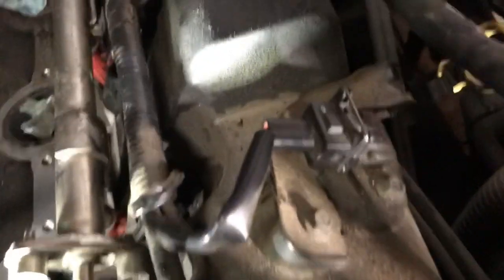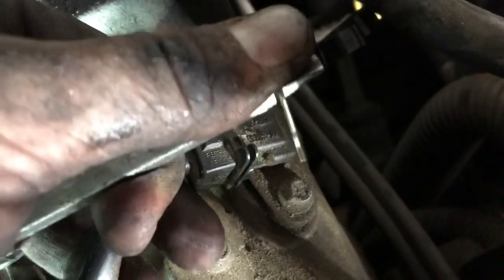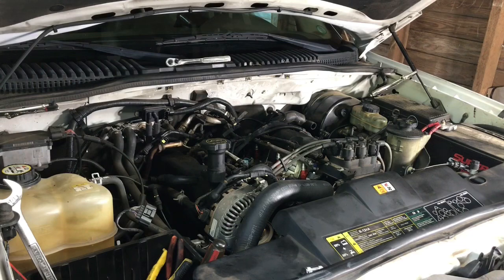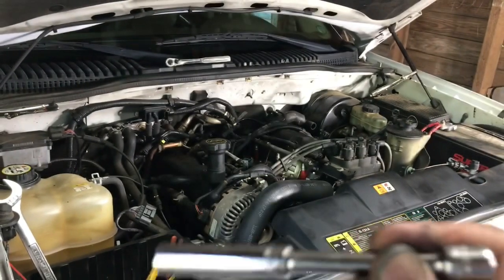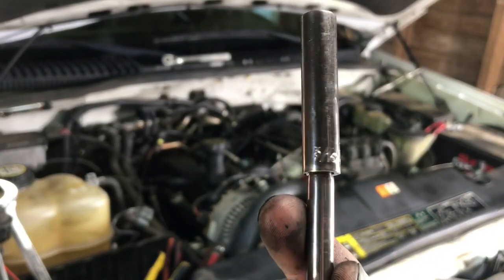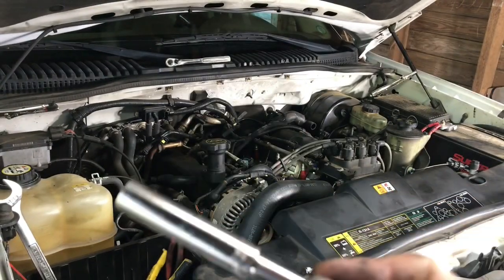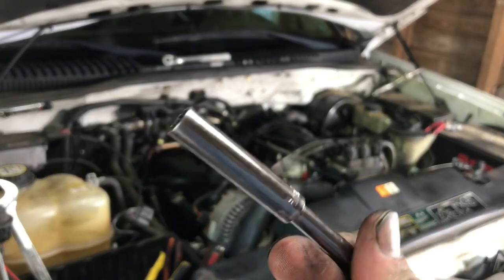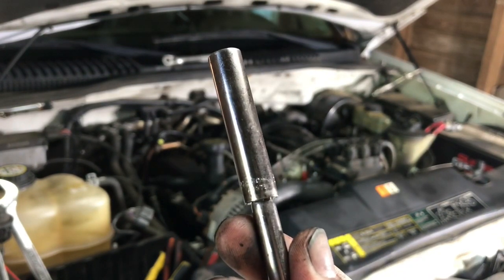On the driver's side at the front, there's a little sensor that plugs up on top of the valve cover. To remove the wiring pigtail, it's got a little metal bar — it's just a little clip. Remove that and it'll slide right off. Now it's just a matter of getting all the fasteners off the valve cover. They seem to be 5/16ths, and you're going to need a deep well socket. I'm using 1/4-inch drive because I don't have 3/8-inch drive deep well sockets this small. That'll also work better because these fasteners are very small and using 1/4-inch drive means you won't risk over-tightening them and stripping the threads.